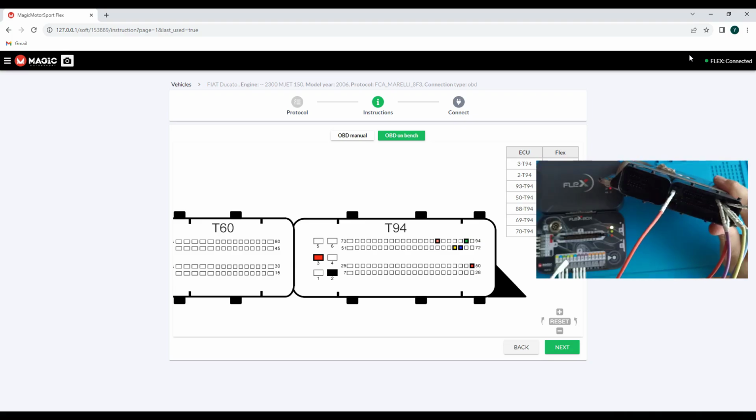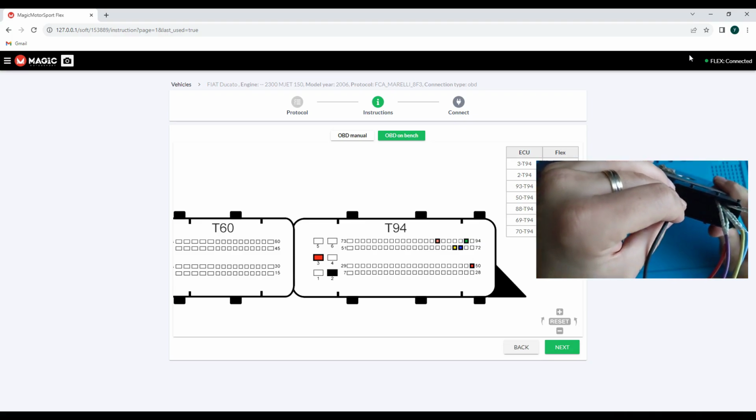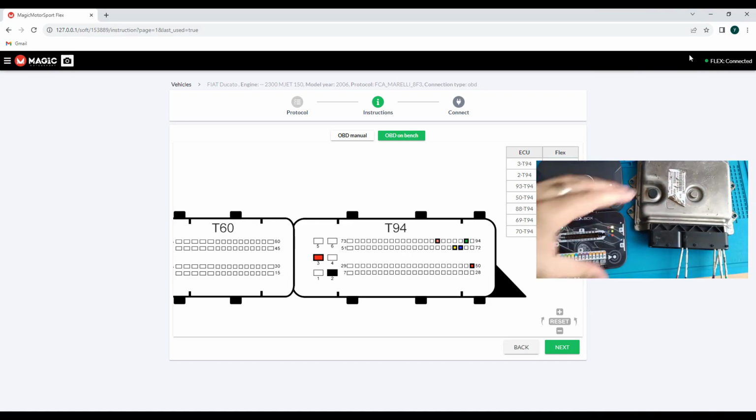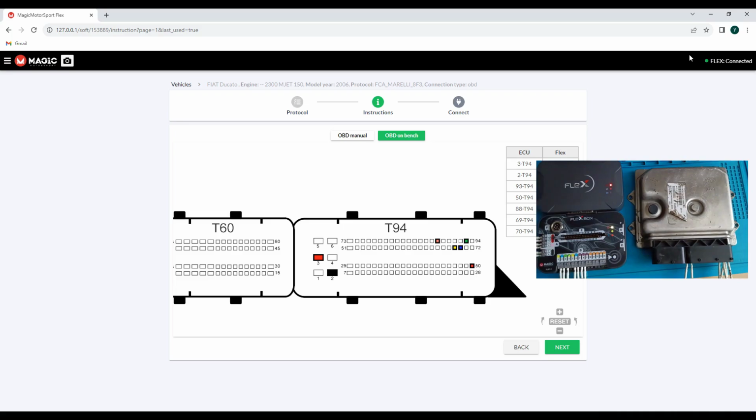I will show you with the mouse on the screen what I want to tell you. All the time it's better to show you than tell you. Pay attention over here on the corner. You have the 12 volt. According to our connection it is A2, should be this one, okay, pin 50. And on Bosch it's the opposite. You have the 12 volt on pin 28.